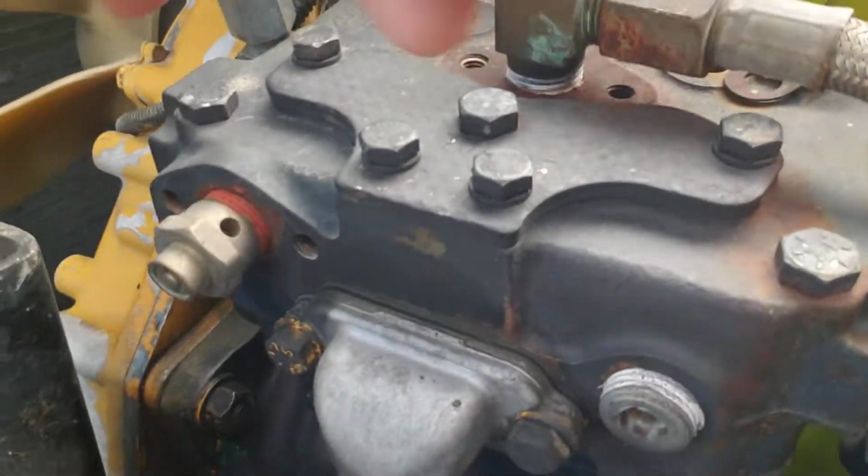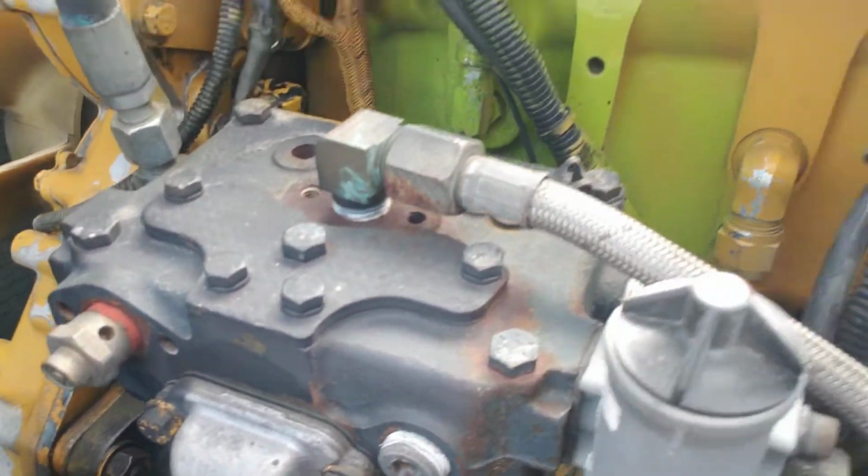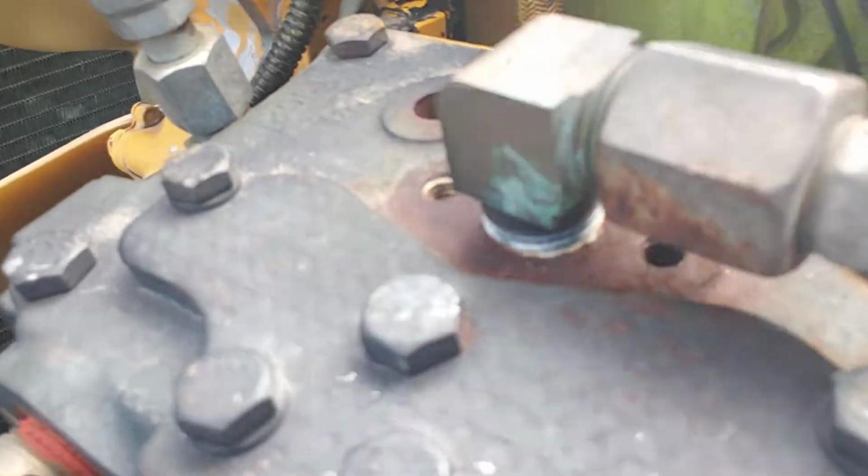that's where it leaks. And how do I know that? Because I got in there with a flashlight last night, and because it's clean, there's no oil anywhere, but I could see up in that crack where the plate meets the block. I could see what looked like little pinhole bubbles. I mean, just little tiny bubbles. And I thought, am I seeing what I'm seeing? And I went and got a flashlight and put on my readers and got up in here and was looking down in there with the flashlight, and I thought I saw bubbles.